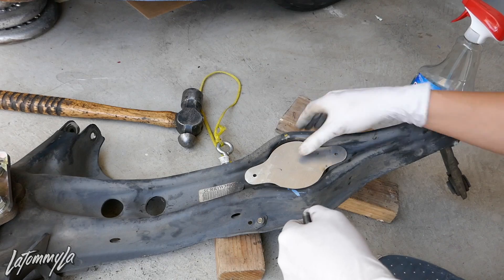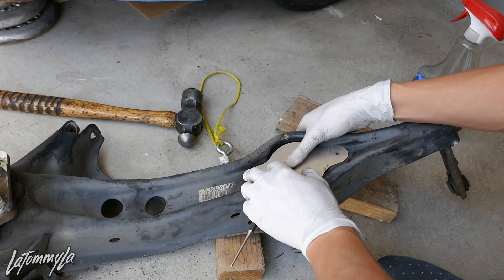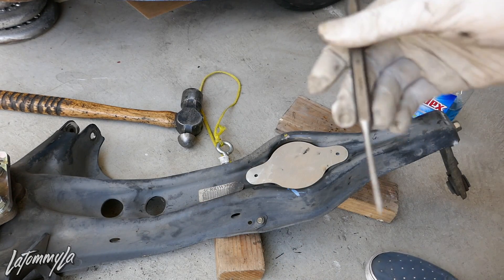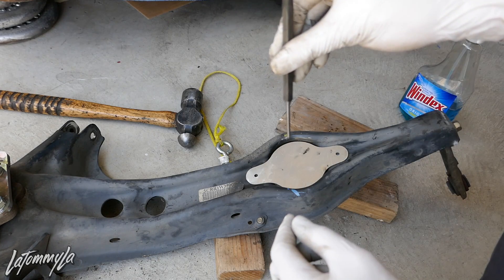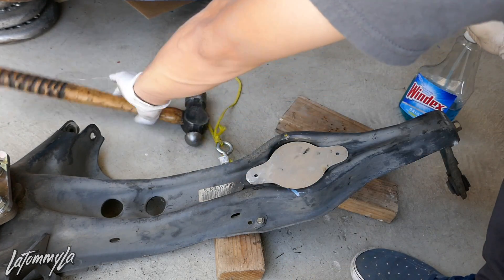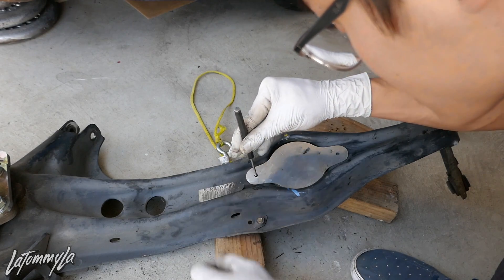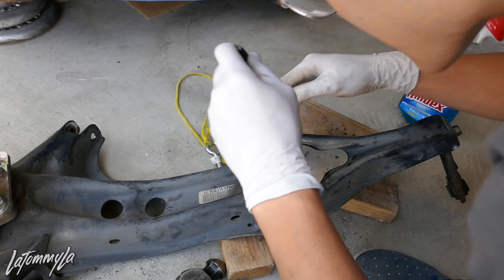Use the plate they gave you — if you have ABS you need the other hole pattern. I use a punch when drilling through metal so the drill bit doesn't slide. You punch the mark and the drill bit goes straight to it. Start with a bit slightly smaller than the hole size, get it centered, and the first hole is done.